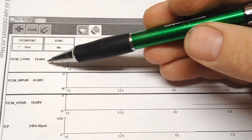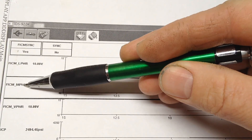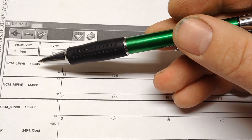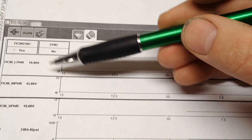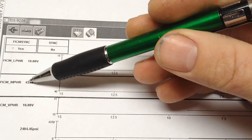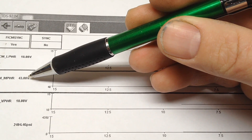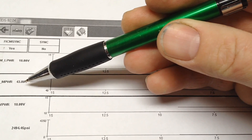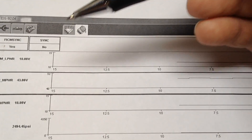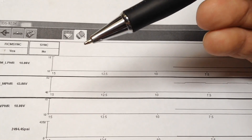What I want to point out is the powers you need to check: the L power, the V power, and the M power. The V power and L power should be battery voltage — 10 volts or higher, even during cranking. The M power is the actual power going out to your injectors, and that needs to be 48 volts to really fire those injectors properly. According to Ford, anything below that will cause misfires and no-starts because the injector spool valves aren't actually moving.